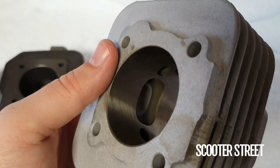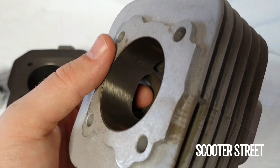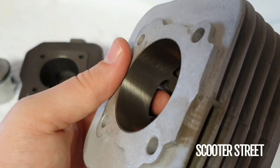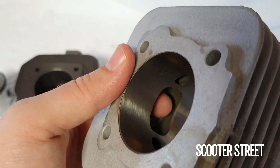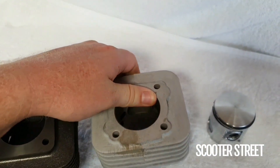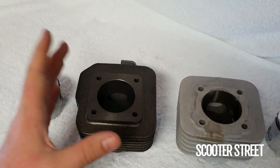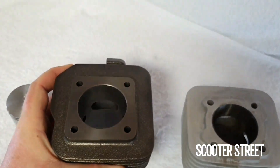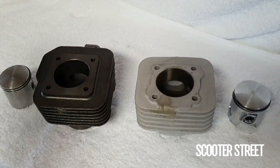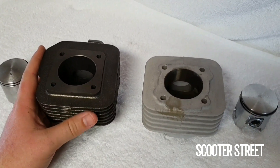The big advantage of this over a race cylinder: a race cylinder has what's called a bridge port — one very large V-shaped exhaust port with a bridge across the centre to stop the rings from slipping through. The only problem with a bridge port is you need a massive amount of revs to get it to start making torque — it doesn't make torque at low RPM. A more conventional port map is really good at making low RPM torque, but due to its inability to get exhaust gases out fast enough, it can't rev to the really high RPMs that race cylinders can.